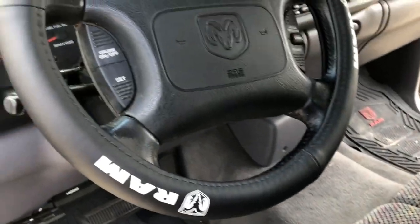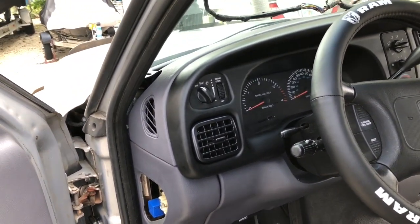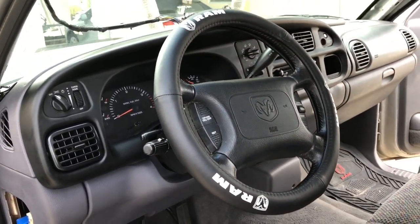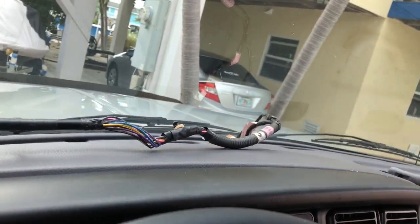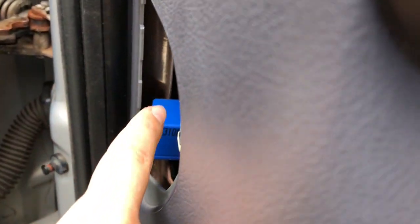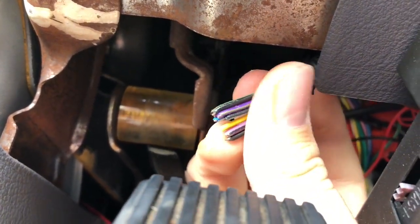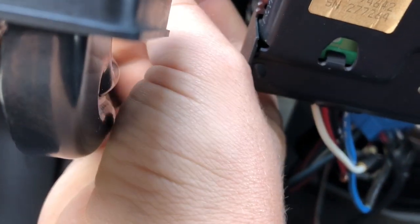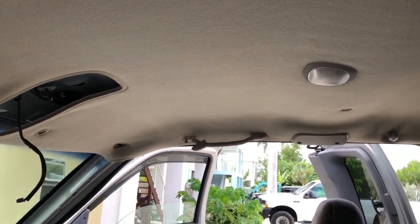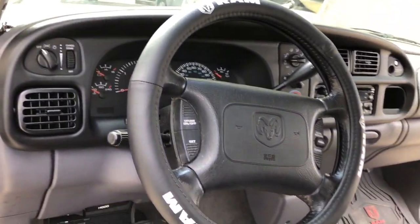I'm hoping that'll be fixed. I tested the truck and it still starts right up — it sounds beautiful. It started right up after six days, so that's good. I got the new harness pretty much in. I plan to snip the wires there and then just feed it down this area, pretty much put it to the same point. And I cut this right here — this is the snipped harness. I don't know what wires contributed to that sparking, but I guarantee you it did not sound too good. I'm grateful that my truck still starts up, but my radio and interior lights aren't working, and I disconnected the batteries after the fact of either shorting something out or a blown fuse.